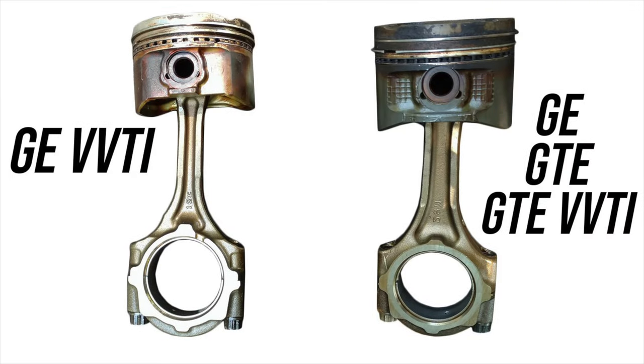Now, another thing you'll see a lot of people on the internet claim is that the GE and the GTE have exactly the same connecting rods. And this is only partially true. All of them have the same connecting rods except for the 2JZ-GE with variable valve timing. Those specific engines came with much thinner and lighter connecting rods, which Toyota presumably used to increase efficiency since the GE really wasn't used in many hardcore applications. They really didn't need that extra strength.